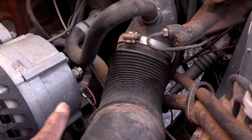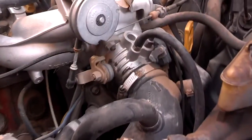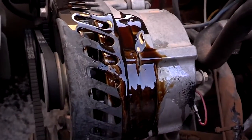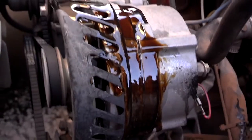I'm going to take these four clamps loose, take this piping off, clean out the piping, and then clean the throttle body. Oh crap, look at the gunk that poured out of that tube — looks like oil. I'm going to have to rinse that off, and it's all in this tube that I just took loose from the throttle body. I need to investigate and find out why that's going on.